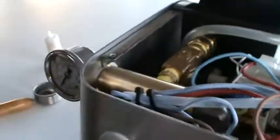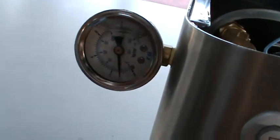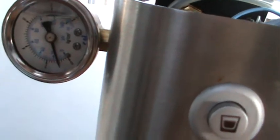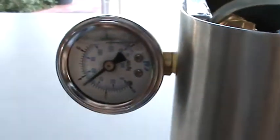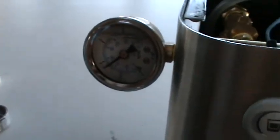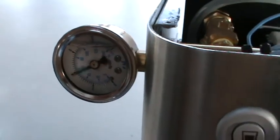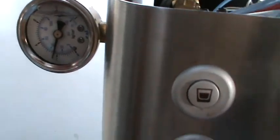Now, here's another test — if I turn the pressure switch on, that should drop. Outstanding. One bar is what it should pre-infuse at. If I turn the pump on to prove it, it should build up a little bit and then sit there. I'll turn the pressure valve off — should build up a little bit. Pressure off. Perfect.